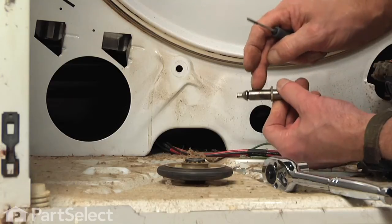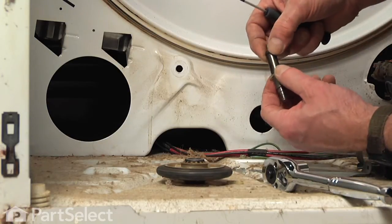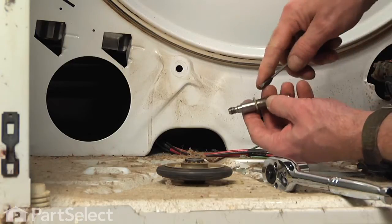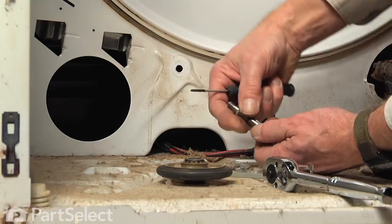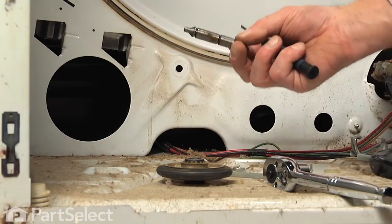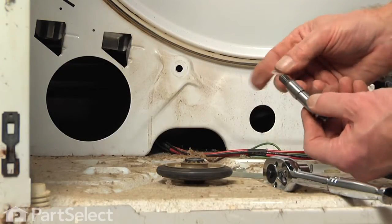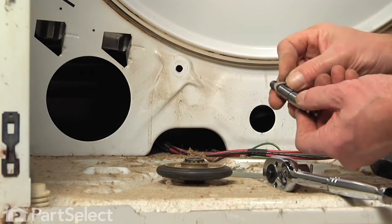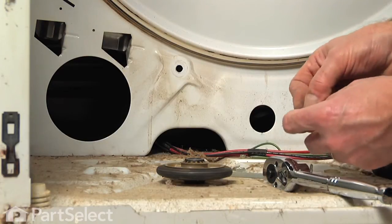If the shaft is worn badly, you will need to replace that roller at the same time because it will have been damaged as well. And we'll slide the back one off of the opposite end of the shaft. You can discard that old support shaft. Before we install a new one, we'll slide that little triangular clip from one end.